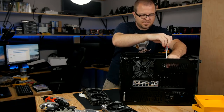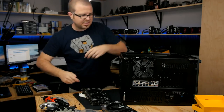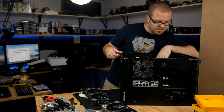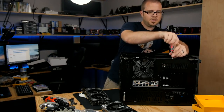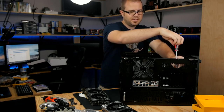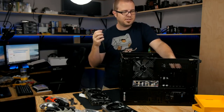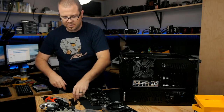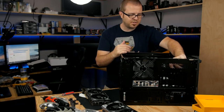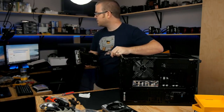I feel like we're in the home stretch, guys. I was anticipating this build would take 1 to 2 hours, and I think it's coming up on 2 hours sometime here soon. But I'm happy with everything. Here we go. The Asus board provides single slot spacing. I don't think there's a standardized way of talking about that, the spacing. So yeah, there's one slot of space in between each of these two slot graphics cards. So you actually have the first slot, second, third slot, and then fourth slot is where the next GPU goes in. I prefer that, especially with these style cards with the fans on them. You want to have plenty of airflow to those if you can.